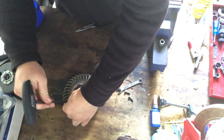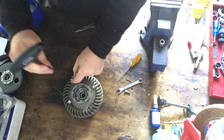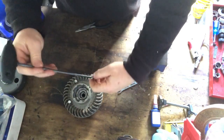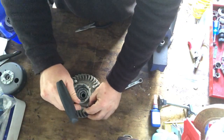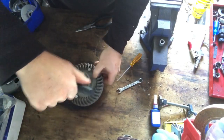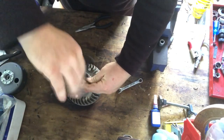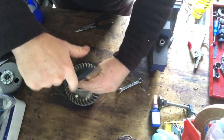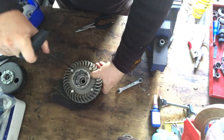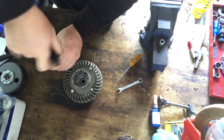One of the things I probably do is I don't screw everything down. I just like to put the screws in to get locations for everything. So you've got location, so you know everything's going to screw down. You don't want to go all the way with one screw and then realise that the rest of the holes don't line up or something like that. And I'll just probably do a bit of a cross pattern on these as well too. That's how I usually like to do things.